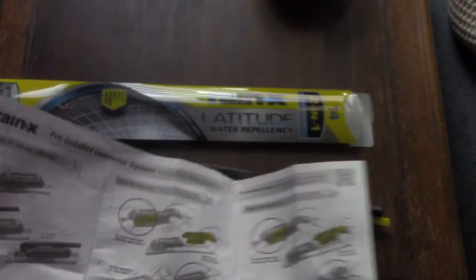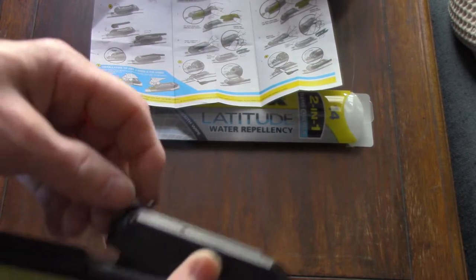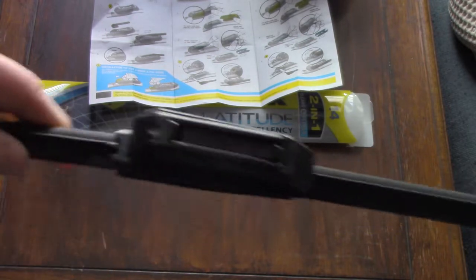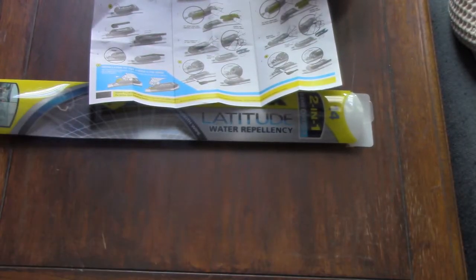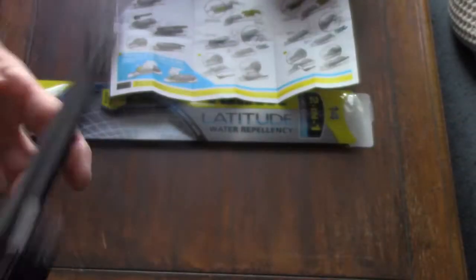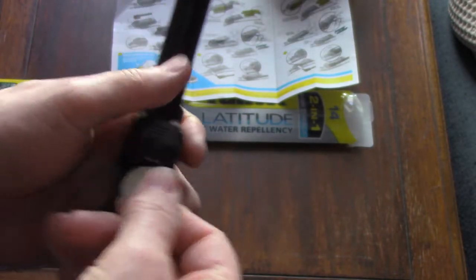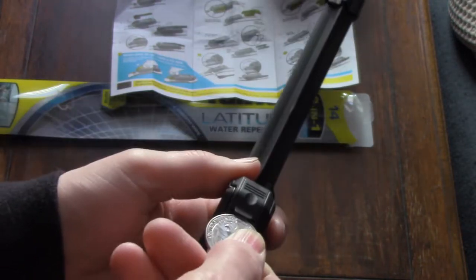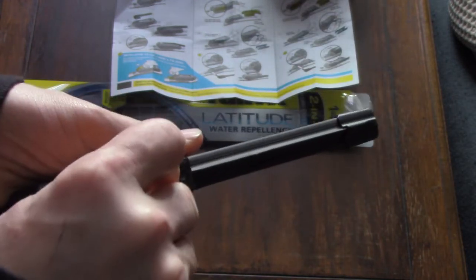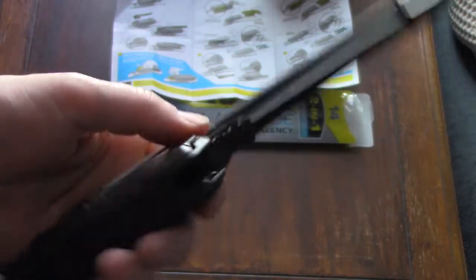There's 4 other ways you can connect this wiper blade. This is the one that I know. So I've already got this little bit of plastic unlocked, but I wanted to show you because it comes like this, and it's in there pretty tight, and it actually suggests using a coin to release this front part of the wiper blade. I'm going to use a coin, kind of get it under here, right, and just kind of move forward and twist at the same time without breaking this plastic.